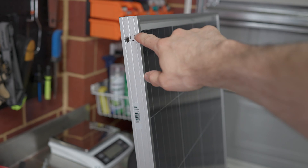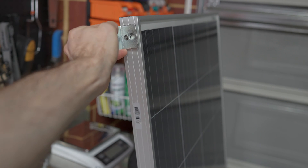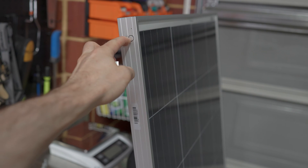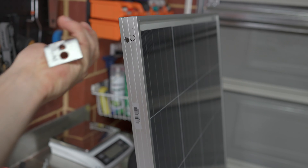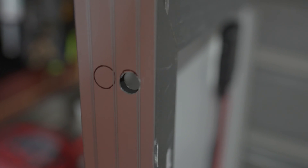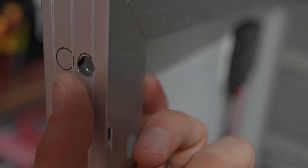After marking the solar panel on the roof, the original hole position was too close to the panel itself, so I drilled new holes through the brackets to bring the nut and bolt further out, allowing washers on the other side for better clearance. I labelled each bracket so they go back in the right spot, as some drilled holes are slightly off. I also drilled out the middle holes, so those will be nut and bolt rather than tech screws. The sidewall is a double wall of soft aluminium, so you don't want to overtighten the bolts.